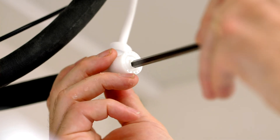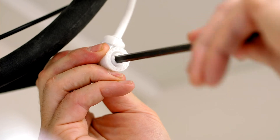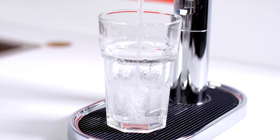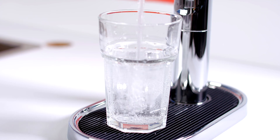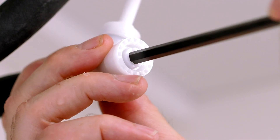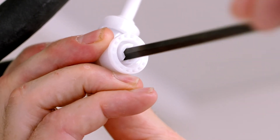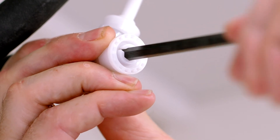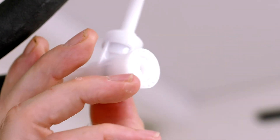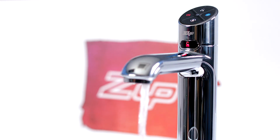The carbonation valve should now be adjusted using an Allen key or large flat blade screwdriver. The carbonation valve needs to be adjusted so the sparkling flow rate is between 1.2 and 1.8 litres per minute. To adjust, first close the carbonation valve by turning it clockwise, then open the carbonation valve one and a half turns. Check the flow from the tap and measure how much water has been dispensed in 15 seconds. You can adjust the flow by tweaking the valve a quarter of a turn each time.